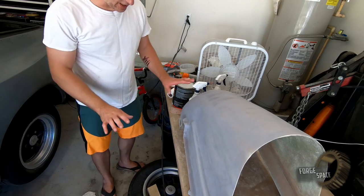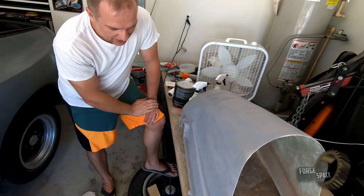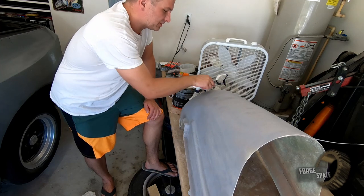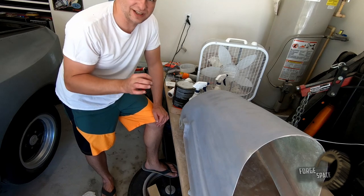All right, so I went ahead, got it kind of dust coated with primer, and then out in the sunlight, you can see a bunch of smaller pit holes, like right here. There's some up here, here. So just little voids. And with those little voids, what we're gonna use is a glazing putty